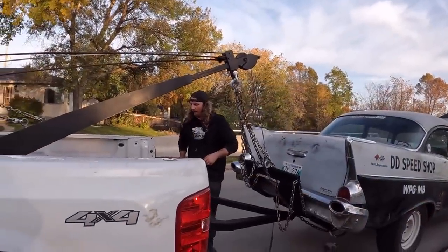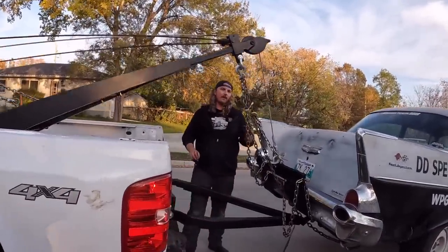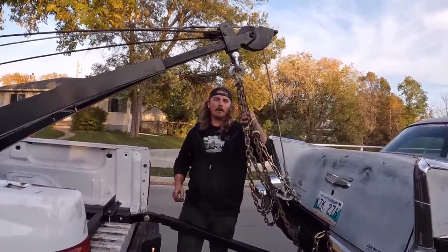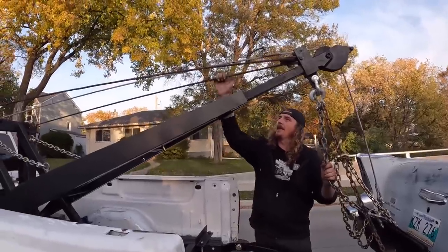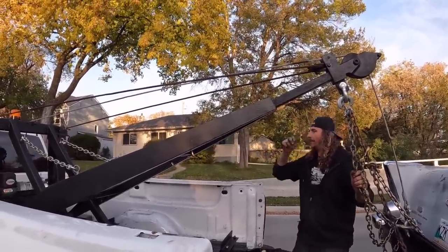Okay, so now obviously there's some home built additions to this, but this chain is probably not needed. But I just like that. Some guys will actually over winch and let it just hang on the chain. I'm gonna do the cable and we have that as safety. And then if the boom, which is held up by this half inch cable, oversize, let go, we have both. Those are grade 70 chain ready to go.